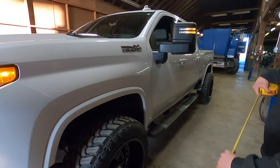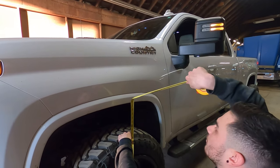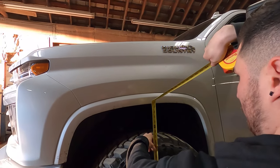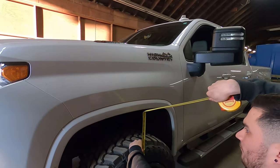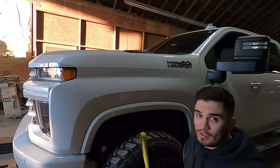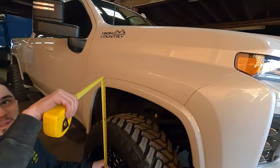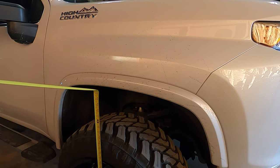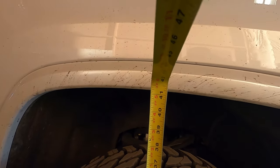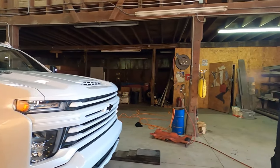Just doing that shift of weight allows the suspension to settle. Taking a measurement — we're way lower. We were about 42 and now I'm at about 41 and a quarter inches. So that was about three quarters of an inch drop with four turns on each side. This one dropped down the same. Both sides are about the same — everything is level. It looks great.